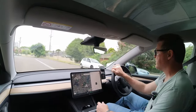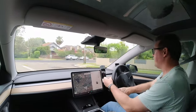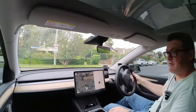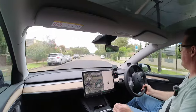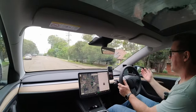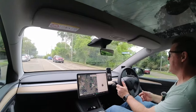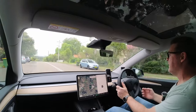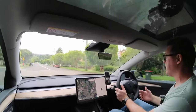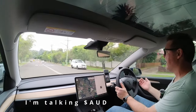I may find during my wheel rotation some signs of wheel misalignment — we're going to look for uneven tread wear. But if I do notice that, I'll probably still just do the rotation myself and then take it for a wheel alignment. To get a rotation and a wheel alignment done, most tire repair places or workshops will charge you somewhere between $75 and $100 to do that.